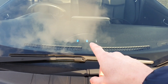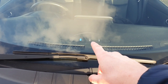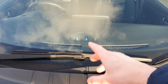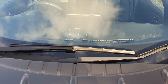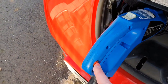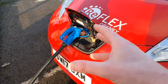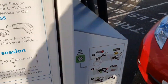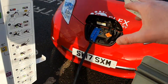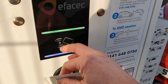As shown on the windscreen of this particular electric vehicle, the indicator lights show charge level — not yet 66% full. When the first solid light is on it's 33%, when the second is solid it's 66%, and a third solid would be 99 or 100% full. On this particular connector there's a little red light showing it's charging. Everything is locked in place — no one else can unplug your connector, whether CCS, AC, or CHAdeMO, because the car will lock the connector in place.